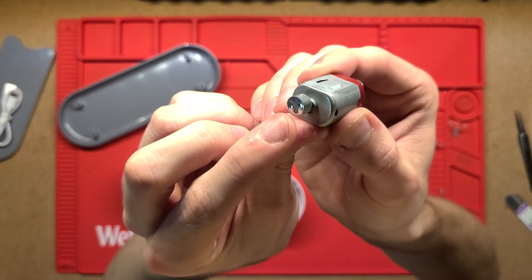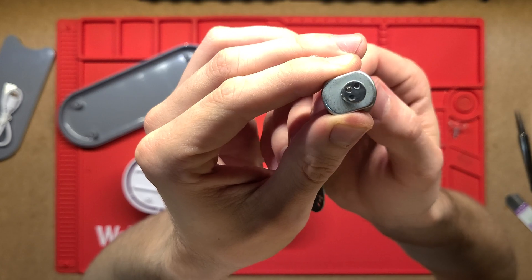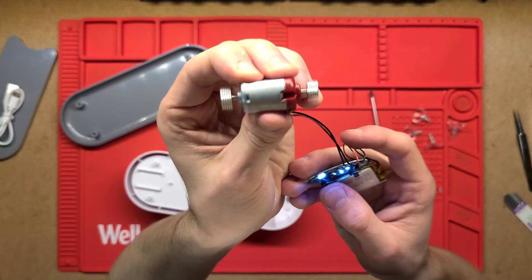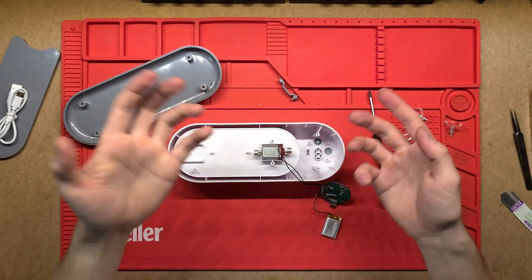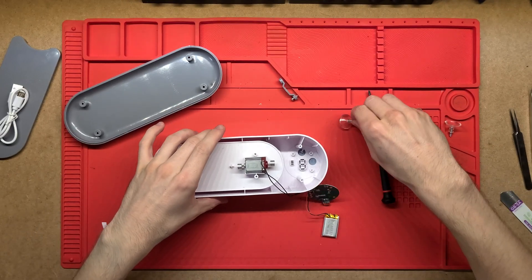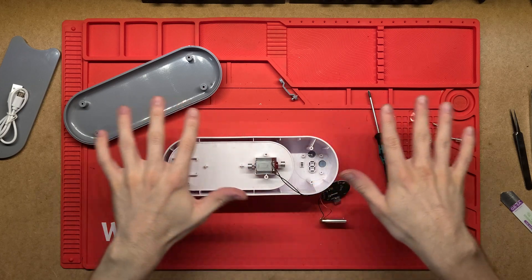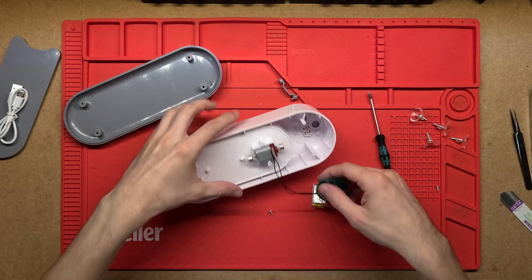As for the motor, the shaft goes all the way through and protrudes on both sides, and there's an offset weight on each end — that's what causes the vibration. The weights are offset in different directions, so it vibrates from both ends simultaneously, and that vibrates the whole case. It's mounted on little suction cups so it stays in place well, even on this mat. This rubber base will absorb a little vibration, but on a hard surface it could get quite annoying since it would just propagate the sound waves through.